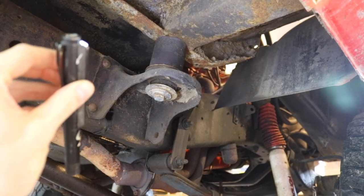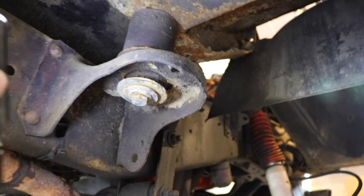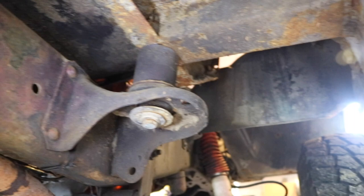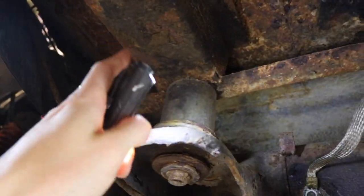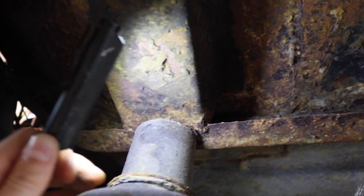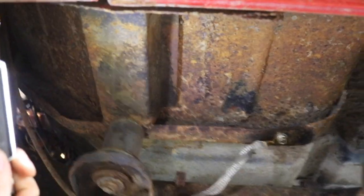There's your body mount with the 70s style cab mount used underneath, with the rubber gone. Watching people on YouTube now — back when I was building this truck there wasn't a video on how to remove square body Chevy body mounts. A lot of people have trouble with the bolts going up into the cab where there's a cage nut or square nut locked in a groove within the cab floor sheet metal, and they strip them out and have to cut the floor. I cracked all these loose and they actually came free — I can't believe it.